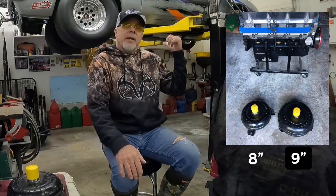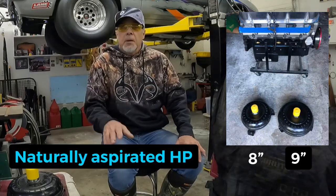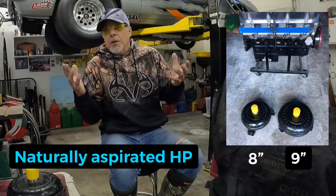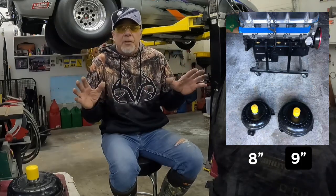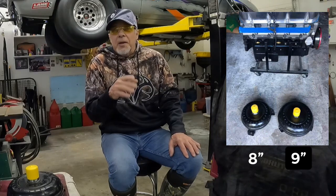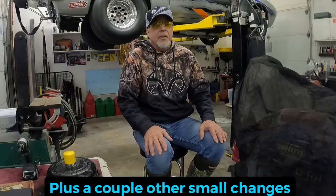Why did they go to a 9-inch? My engine used to make 875 horsepower, and now it's 906 at 6,900 RPM. Same car, different engine build. All we did was change the degreeing of the cam — rather than advancing it on the hit, we left it straight up. That made all the difference from 875 to 906. Unbelievable — I'm shocked about that. The dyno operator at Performance Engineering suggested we go that way because this engine is a big torque monster and we wouldn't need that extra 3 degrees advanced to get more torque off the line. Made a huge difference.